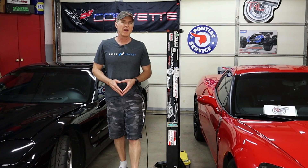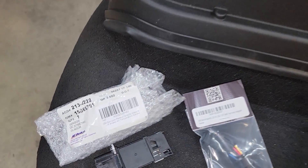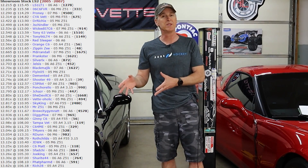This was not intended to be a how-to tune video. In my particular situation, I knew that the only changes made to the LS2 were to upgrade the air intake assembly including the mass airflow sensor and intake temperature sensor, so I was confident that simply recalibrating the mass airflow sensor tables would bring the air-fuel ratios into place — and they did. I'm also hoping to do additional engine mods to the C6 soon, so I didn't feel like polishing the tune to 100% only to redo it a month later. And since I'm heading to the drag strip in just a couple of days, I wanted the tune close enough at wide open throttle to get a quarter-mile baseline to compare against stock LS2 C6 numbers and beat after future mods.